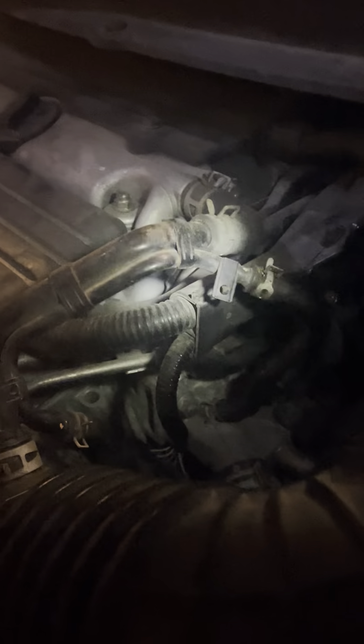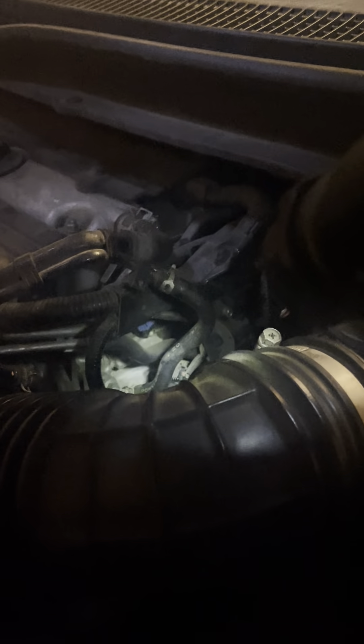Check the hose on both sides. In my case, I found out the leak was coming from this small hose right here that goes to my thermostat housing — a tiny hose, probably a ten-dollar part. I knew I had a coolant leak because whenever coolant leaks it leaves a corrosion-like residue — kind of like barnacle corrosion — that looks greenish.